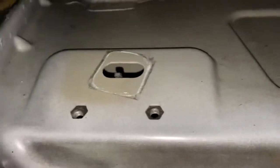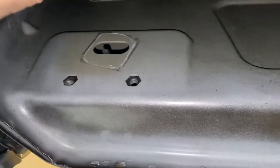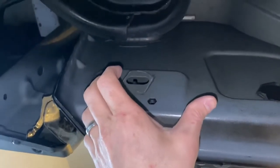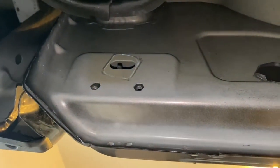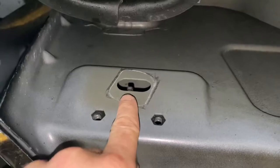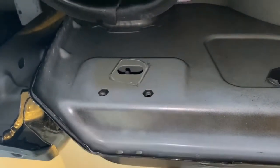That way it'll hold it in place. Then what you're going to do is take your mounting bracket up here — this will not push out of the way — so that way you can thread it in from the top, because it is very tight and hard to get to. But once you get that thread in, you can actually twist the mounting motor out of the way to remove this bolt, so when you put it back up you can put the bolt back in and it'll be attached. I already got one installed over here, hand tight, and I'm putting this one in next. The easiest thing so you don't make a mistake: set the mounting threaded bracket in there like this, thread down either side just hand tight, and that'll hold it in place until you get the first bolt off your motor mounted to it.